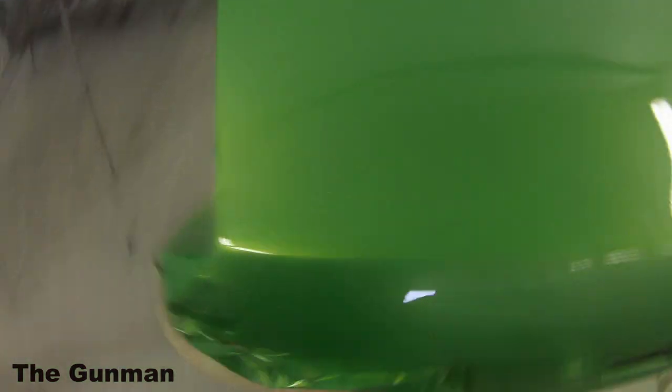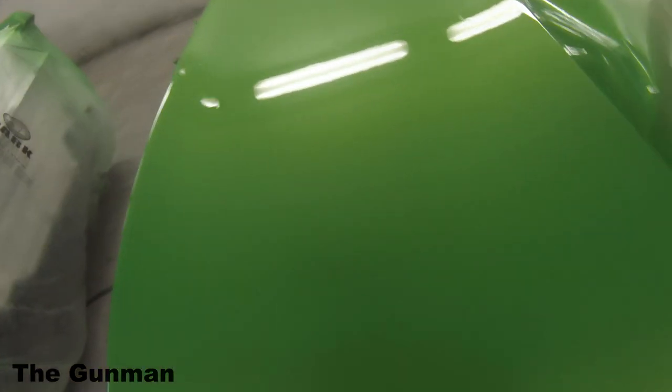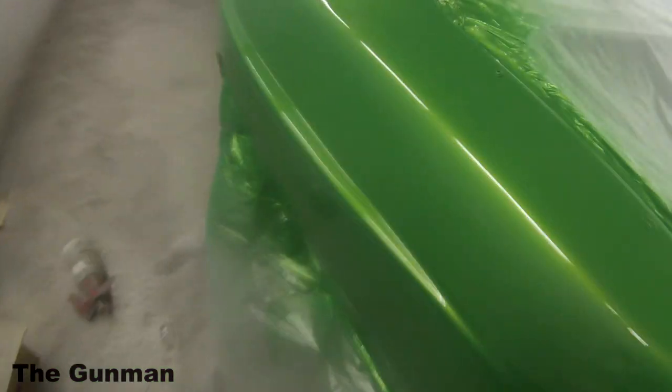Well, not the most amount of sun, but it's outside and it gives you a bit of a better look at those hologram flakes that I've put in it. I really didn't put much in. It was 1 liter of intercoat, which is basically the clear base coat that you can mix your pearls and stuff with. And then all it was 3 teaspoons of those DNA hologram flakes.